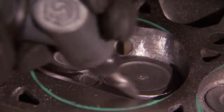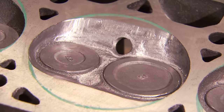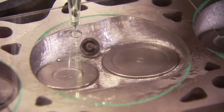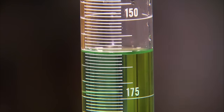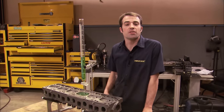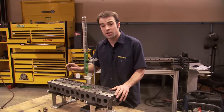Ideally, you need to get this done before you resurface your head. Either way, take your time and take it slow. The slight texture left behind is not going to matter in our case. Just make sure that you don't leave any hard angles behind that could cause hot spots. Our new measurement is 60 and a half cc's, so that means we picked up about three cc's, which should bring our compression ratio down from 9.6 to 1 to a much more manageable 9.3 to 1. And that'll keep us from having to spend the extra cash on some premium fuel. We'll repeat the process on these other five chambers and make sure they all equal out.